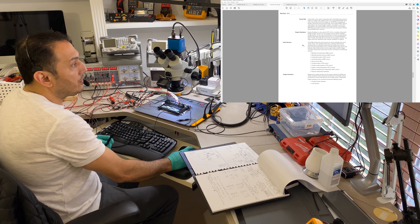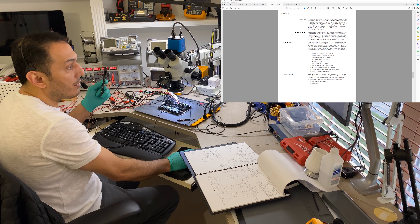Very specific for this 8.1-liter engine: if both throttle position sensors fail simultaneously, that triggers DTC 2135 — engine shutdown. This condition occurs when both throttle position sensors are out of range and giving unreliable data. In that case, the ECM does not have accurate throttle position information and, rather than allowing an uncommanded wide-open throttle, the ECM shuts off the fuel and ignition system. I have both throttle positions connected just in case.